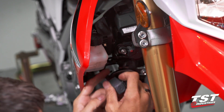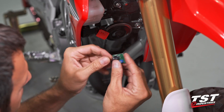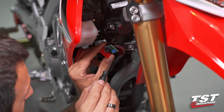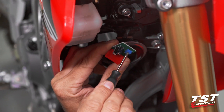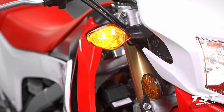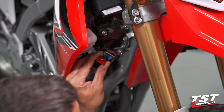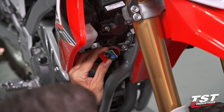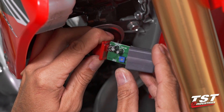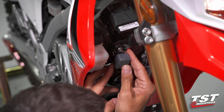If you want to adjust it, you can strip off that gray cover and remove the circuit board. Make sure that you don't touch the circuit board or any of its components to anything else on the frame. Like I said earlier, the micro adjust can slow things down drastically or speed them up to a crazy speed — somewhere in between there is probably a setting that you'll like. We'll leave it here; it looks close enough to OEM. Slip the cover back on. There is a channel here that fits the circuit board — the circuit board must be inserted in that fashion. Once it snaps back onto the tab.